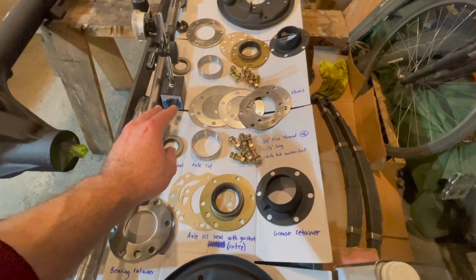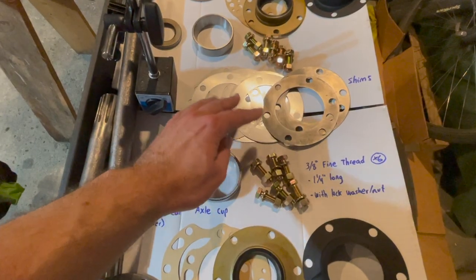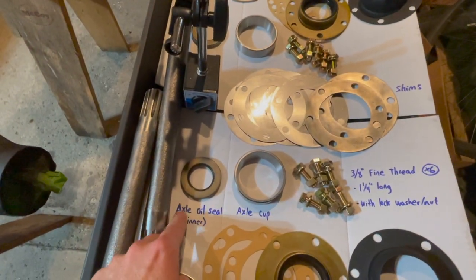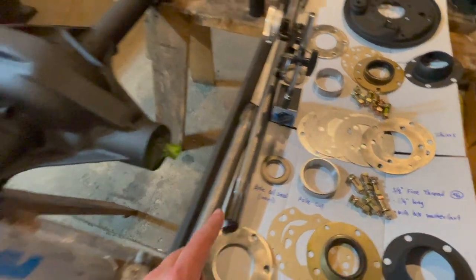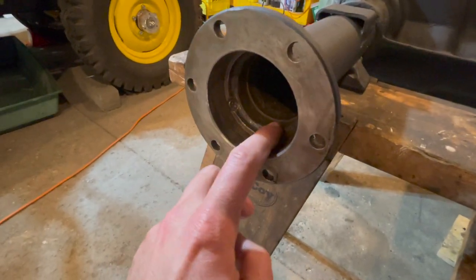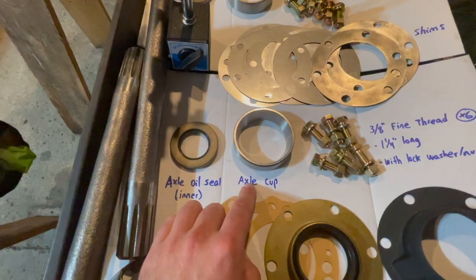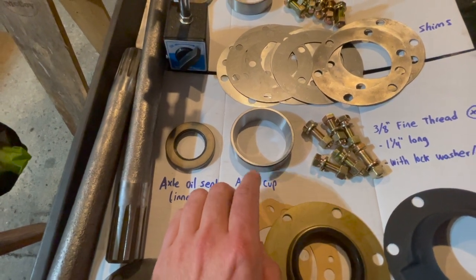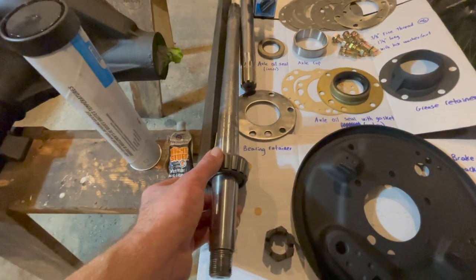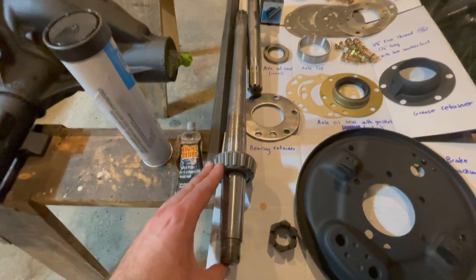This shim kit will separate the passenger side from the driver's side. Working downwards from our shims, we'll go over all these different parts. Starting on your left, this is your axle oil seal inner, which will actually be installed in the inner of your axle housing. Then the axle housing end will push the seal right against the farthest lip. Next, the axle cup — also called your race — will be installed onto your axle shaft, on this bearing which will ride on the cup, and this bearing has been already pressed onto your axle shaft.